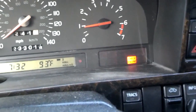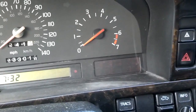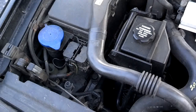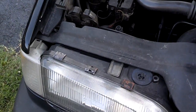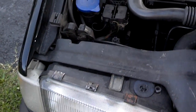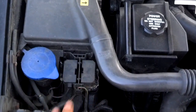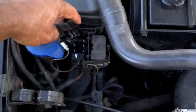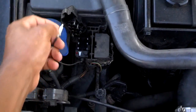The first thing you want to do is turn the car totally off. Reach down, pull the hood release, and open the hood. Once you have the hood open, locate the OBD1 port box just behind the passenger side headlights on US spec cars. There are two boxes there. Lift up the cap on the box that has 'A' on it and unplug the jump wire from under the cap.